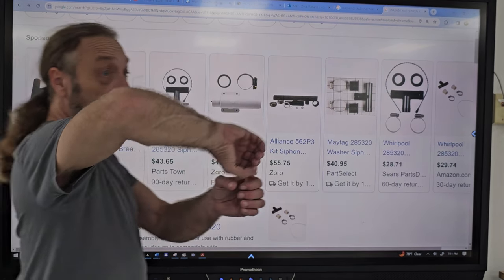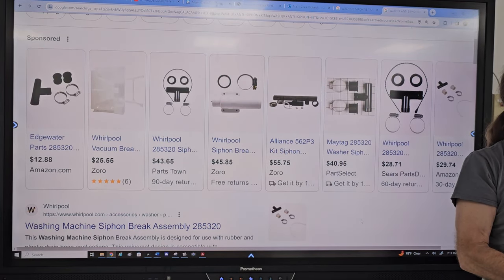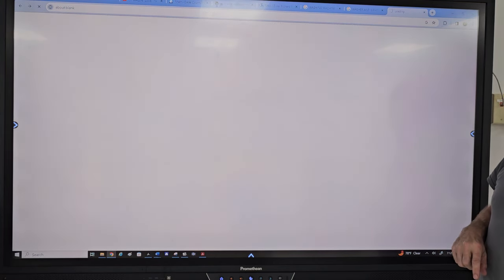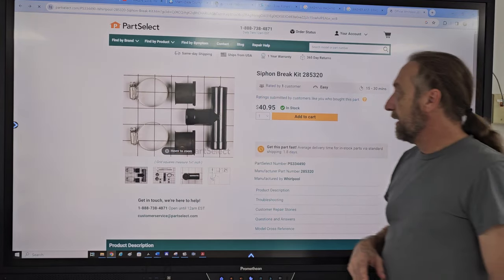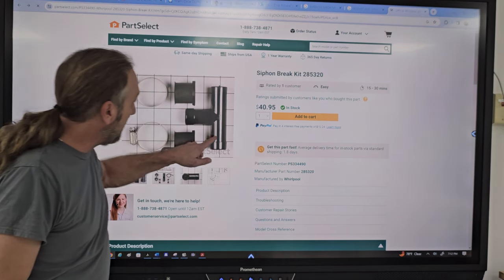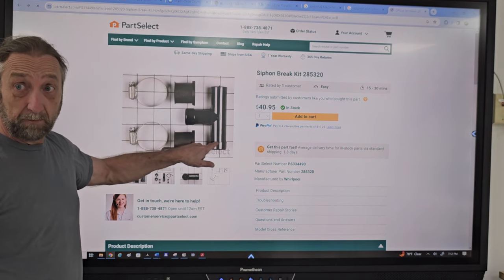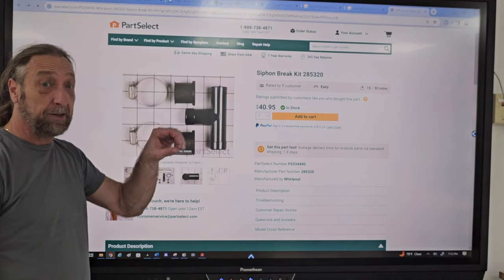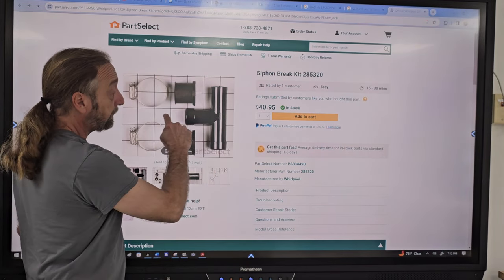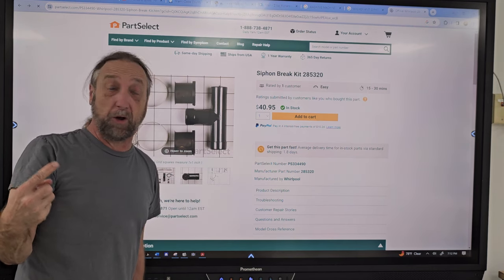And you know how the washing machine has a curve going down into the drain pipe? Well, you cut that curve. So you hook up the drain hose into the side of this pipe. And you usually have an arrow pointing down into the machine. You have a piece of hose here. You cut off the end of the hose, you put it here, and you put the end you cut off here. And when you do, the water comes in and goes into the drain pipe, and now I can tape it to the drain pipe so it don't overflow.